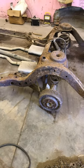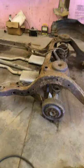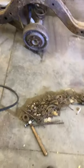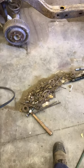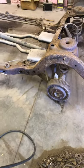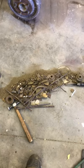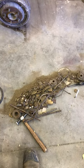All right YouTube, we're back — 1975 Caprice drop top. We're gonna go ahead and dive in on this frame today. As you can see, this pile is from the holes in the frame. I took pieces of that broken brake line, just jabbing it through there and running the air hose through it — that's all the rust and dirt and stuff that came out of the frame.